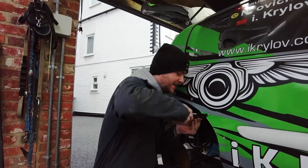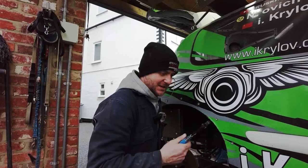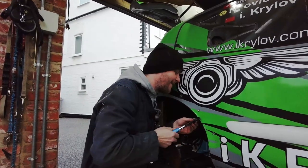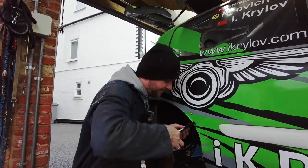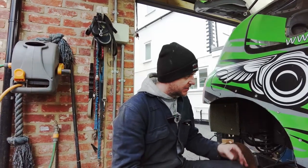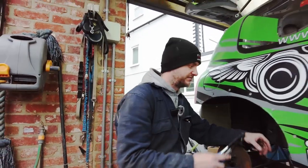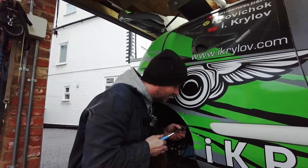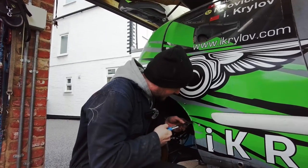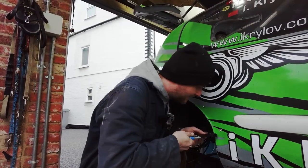On this episode of 'how to use the wrong tool for the job' — we're using a driveshaft CV boot crimping joint to make a little edge lip flare. Why? Because Rob said so. In fairness, we don't want a sharp edge in case the tire touches it, so if we roll it a little bit out we have space, and the rest will just fill with tiger seal. It's not structural but should give us enough strength and seal it at the same time, and we don't need to weld anything.